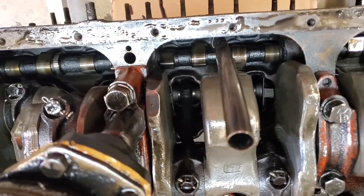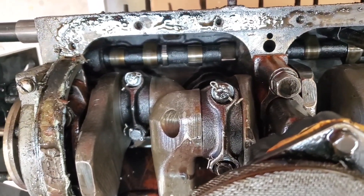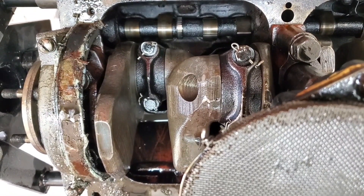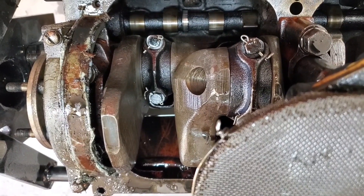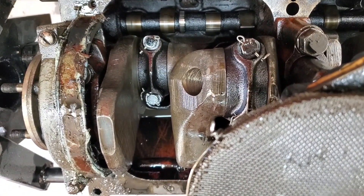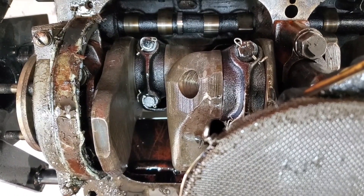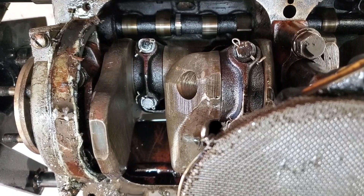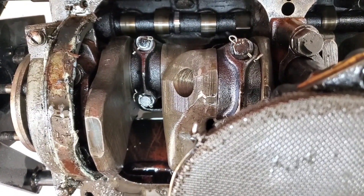Let's look at some more things. You'll see massive amounts of silicone in use — it's not how to install things. And believe it or not, they put gasket paper over the ends at each end of the crankshaft. That all has to be changed and done properly. When we drained the oil out of this, it was super thin — also not a good indication.